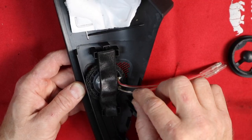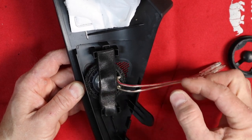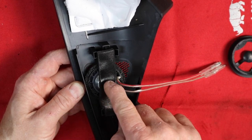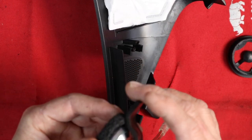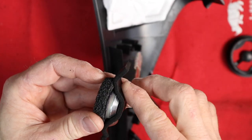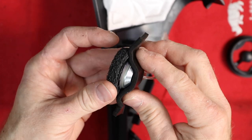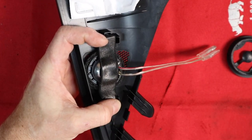Once it cools, what you'll have is a mount that conforms to our two screw provisions and also to the tweeter itself — you can see where it even got into the dip in the back of the tweeter. We now have a perfect mount for the tweeter. The creases of the tweeter are in there, which is going to hold that tweeter in place and make it a nice solid mount. Now we have to drill two holes to screw it back in place.